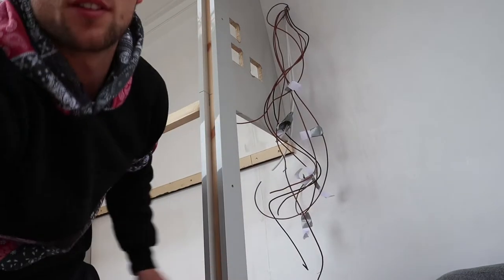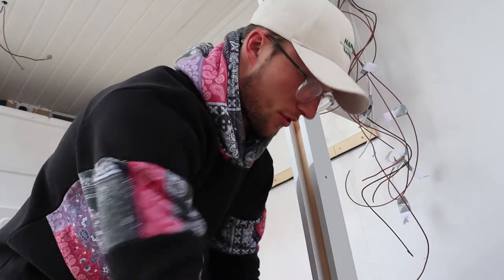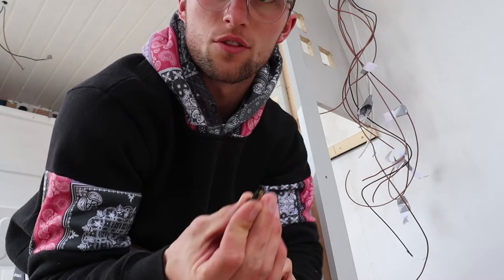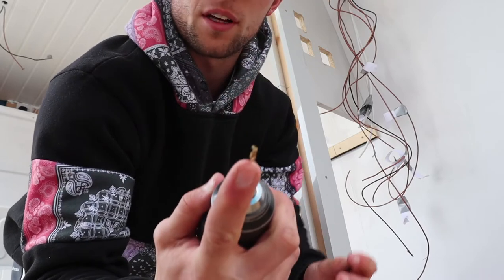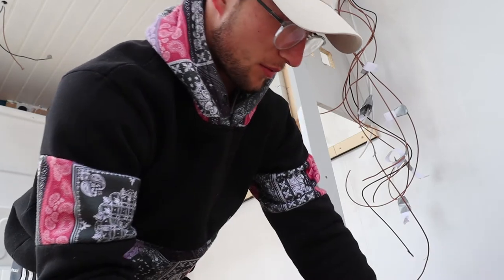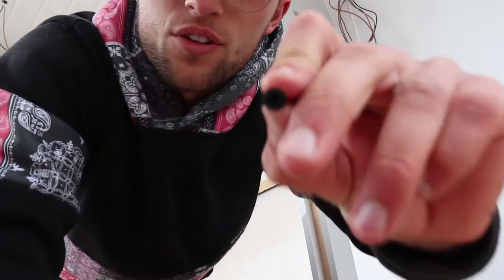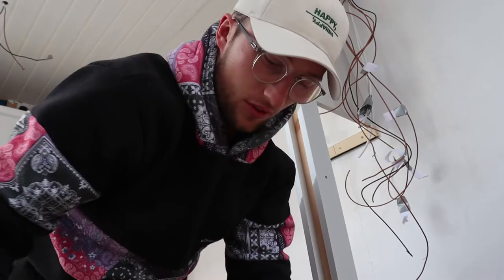If you have a shiny surface you don't want to damage going into the wood like I do here, you're going to want to make pilot holes with a drill for the screws — slightly smaller than the screws so it goes in easy. This one's probably slightly a bit big but I'm not going to go all the way in. Also you don't want to scratch the top of the screw, because if you scratch it it will look like a bad finish and you obviously want a good finish.